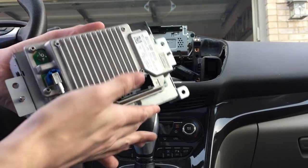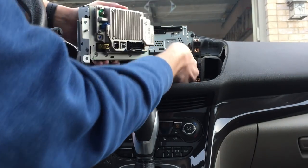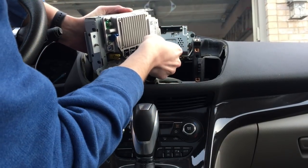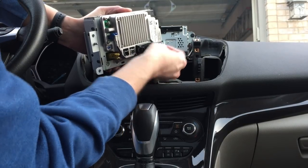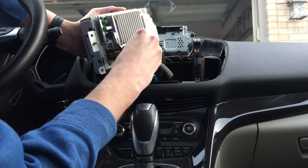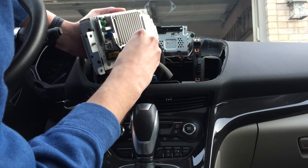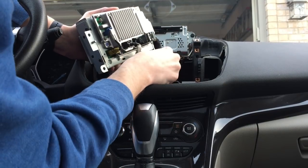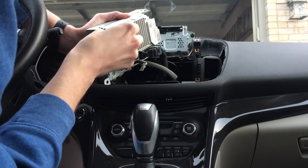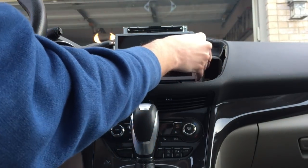Okay, it's now time for the moment of truth. We take our new module, and this cable doesn't go out very far, but we get a little bit. So we just plug that back in and then swing the arm and it clicks back in. We take our USB and plug that back into the black connector. The gray USB connector is actually unused. And then our GPS cable plugs into that connector. And this will set back on the posts, ready to be screwed back in.